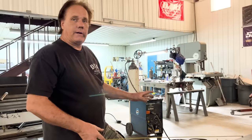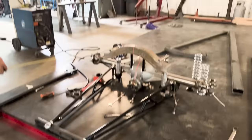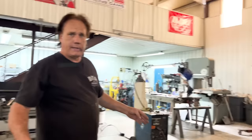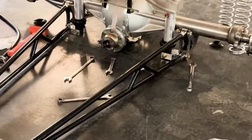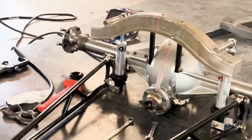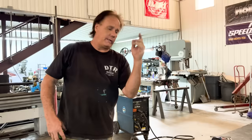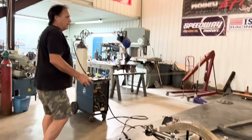Now I come up here and measure from this nut, measuring off of the points - they're both laying flat on this piece of tubing. If I measure across, that's six and an eighth. Turn it around - six and a sixteenth. So we're that close to being exact - that gets me square. Everything is squared perfectly. The spread on these couldn't get any better - lasers don't lie. So what I'm going to do now is go back there, tack those brackets on top, bottom, left, right, and have them where those brackets don't move. Then I'll put the tires on, roll the rear end back with the crossmember. I've made temporary braces bolted through one of these bolts in the housing, holding the crossmember up at the right height. Now that we can assure ourselves it's centered and everything's stabilized, I'm going to roll it into the car, set the car at the right height, put the front suspension together, get it set at right height, and then start connecting the dots.